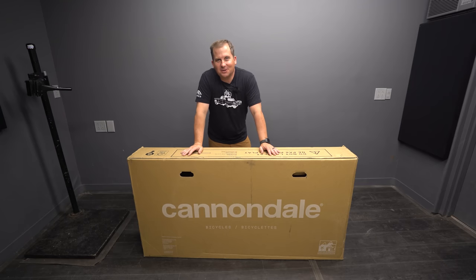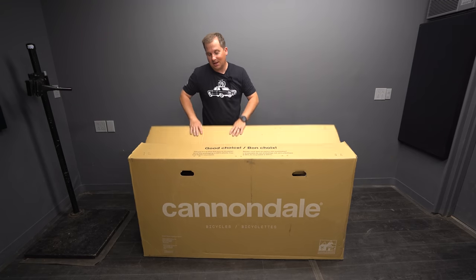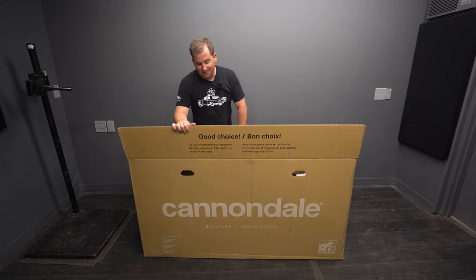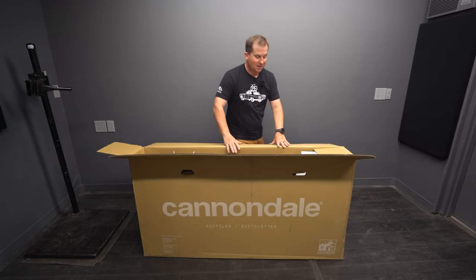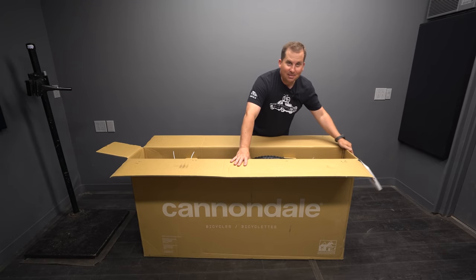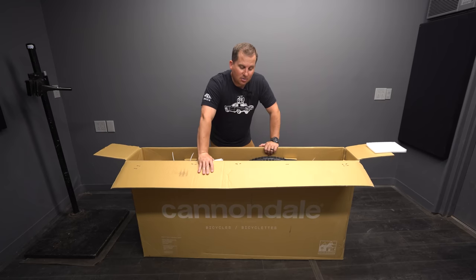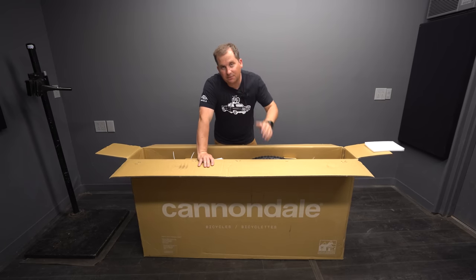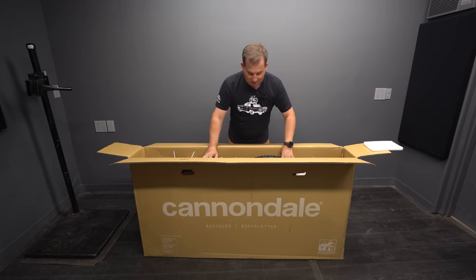Today we're taking a first look at the brand new Cannondale Habit HT2. Back when I started mountain biking, Cannondale was the dream bike to have, and they're still going strong with some killer bikes, and I've been excited about this. The new Habit HT, their hardtail, their aggressive trail hardtail. I always love to review under $1,500 bikes with good geometry, and that's where this is today.